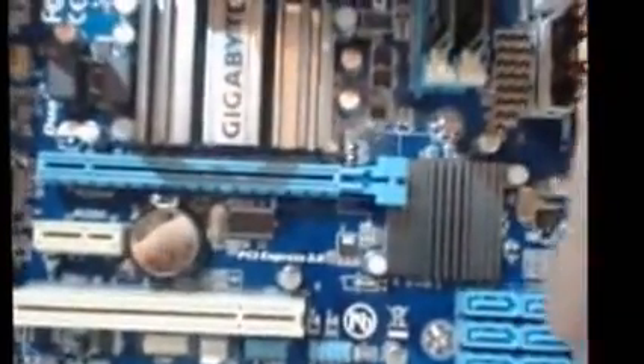Since I've been doing these computer builds all these years I'm pretty confident in myself, and I did run a boot test and we are booting up, which is a good thing. So this is the basic computer setup right now. All we're going to add to it now is a DVD burner up in these drives here, and down here we're going to mount the hard drive. Then we'll install the software and plug in the SATA connectors on the hard drive and the DVD burner. It's looking pretty good. We'll have a part three and maybe a part four, so bear with me.